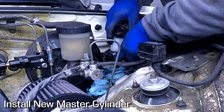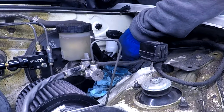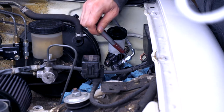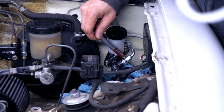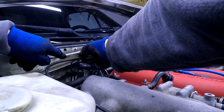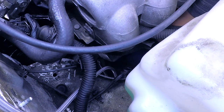Let's install the master cylinder. Next, let's install this fitting adapter on the master cylinder. That's curious — I was expecting this fitting on the braided hose to crush this copper washer on this adapter piece, but as you can see it's just kind of sitting here and it can't go on the other side either because this is already snug. We've gone ahead and routed this down — it's in position. Now we go under the car.